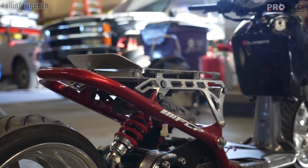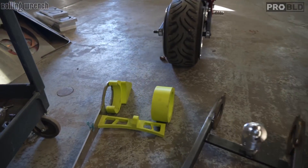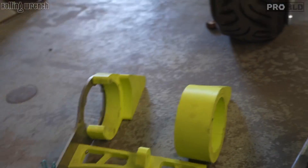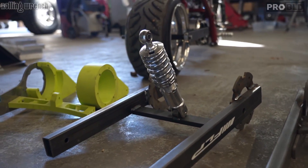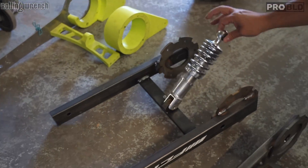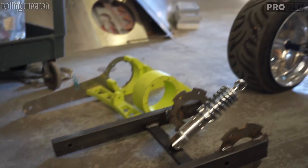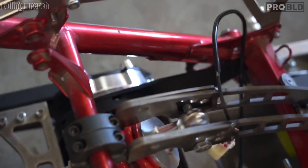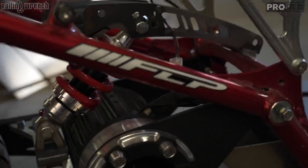So over here you can see first generation — second generation actually. These are the swing arms. So that was like the initial idea of making it full billet. That was 3D printed. These little neon pieces are 3D printed — proof of concept. And that was going to be uber expensive. So we kind of went with this machined steel swing arm. This was our second generation shock, a traditional Ruckus shock, but we found it was way too soft and springy, very bouncy. So then we went to this big beefy one, and that one does the job and it looks good. And then we don't have to make any adapters on the bottom so it's centered — ready to go.